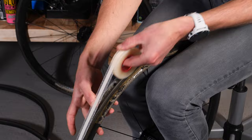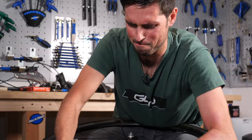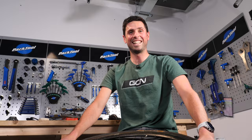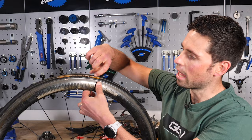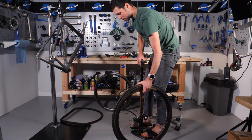I'm going to start by gluing the tires on. Having wrestled the tubular tire on, I can inflate it, look to centralize it, and then, with these little tabs which we've got left out of the side, we simply lift the tire ever so slightly off and peel the top protective cover on. We're left with a sticky surface on both the side of the rim and on the side of the tape on the tubular tire. Inflate it to the proper pressure, leave it be. Tub glued. Just got to do it for another one now.